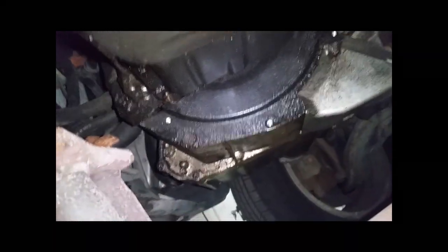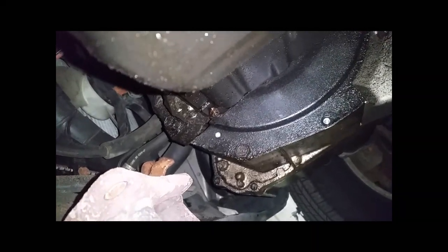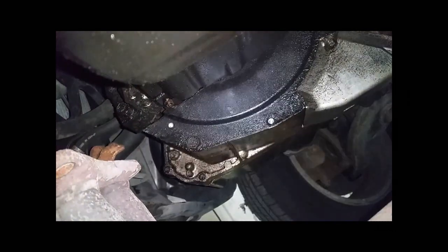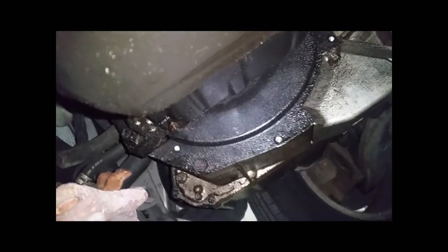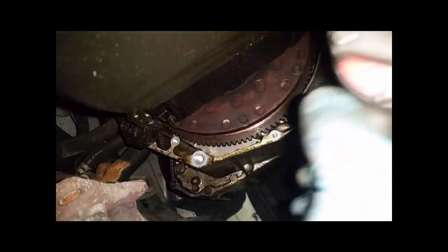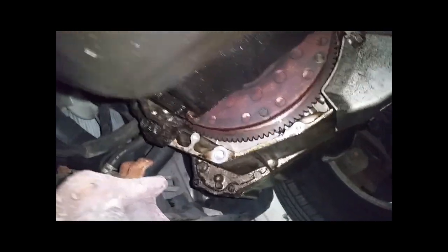The annoying part would be to lose any of these bolts. Got the flywheel cover bolt with one hand — that's a 17mm — air impact on there, and the plate came off, just fell out. Now we have a clear shot at the rest of the oil pan bolts.